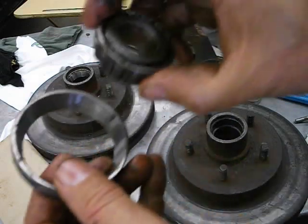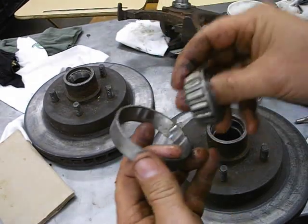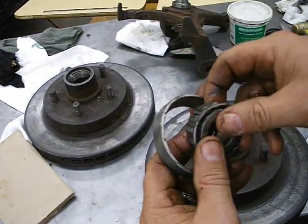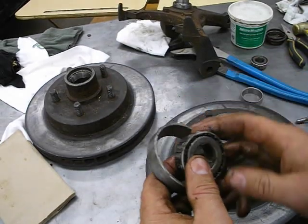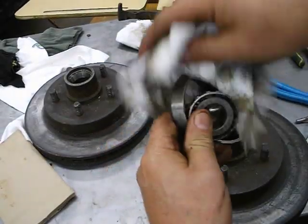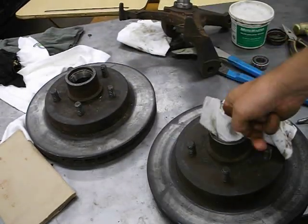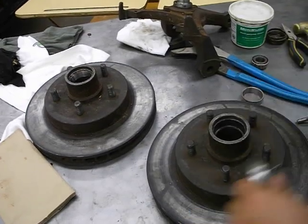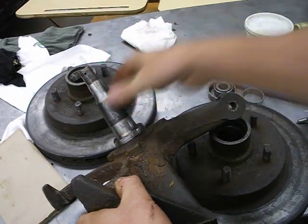So, I've got my race out and I've got my bearing. You're going to take these over to the wash tank, wash them out, make sure they're nice and clean, then dry them all off. Clean out the inside portion of the hub with a cloth rag — be careful not to cut yourself, there are sharp edges on the inside. Get all the old grease out. This is called the spindle — that's what the races and bearings sit on.